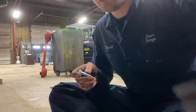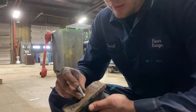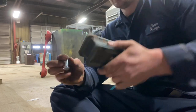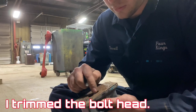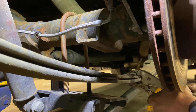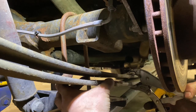Now if you get a new bolt, you need to make sure that the bolt you get will fit into your lowering block, because the lowering block sits on the spring and the head of the bolt sits above the spring. This bolt is obviously a little too large, so I'm just going to do a little clearancing right there to make it fit. Make sure that is back where it is supposed to be.